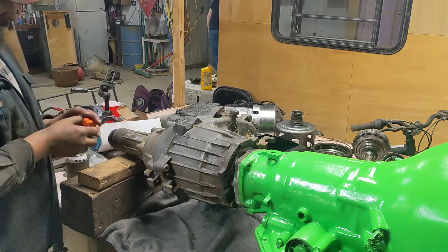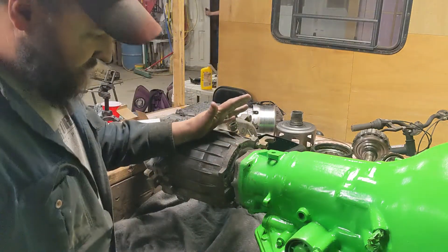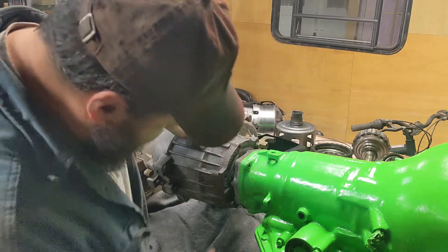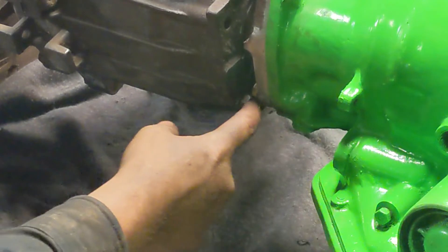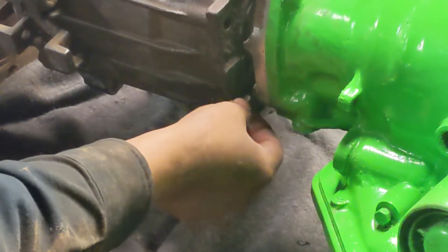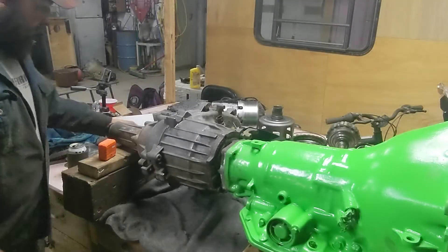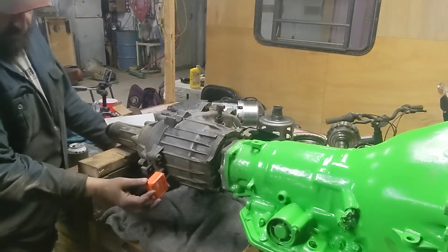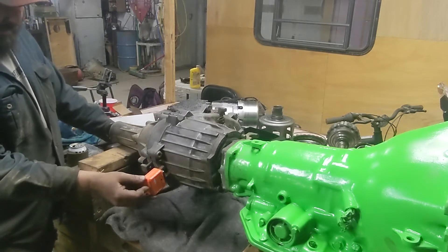At 71.4 degrees, this is the current configuration and clocking that's in the Jeep. It shows me where my problems are — the same problems I have with my current adapter. These two bolts are going to interfere. I could go with an allen head bolt and maybe make it work, but I think the smarter decision would be to just re-clock my transfer case. A little tip: if you guys don't have scissor jacks around your shop, you should — they're great for stuff like this. I can take my scissor jack under this side of the transfer case and adjust that angle.